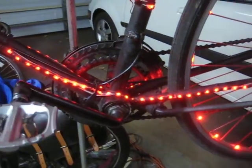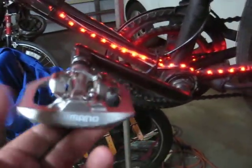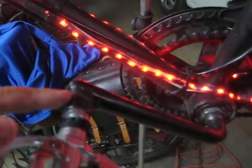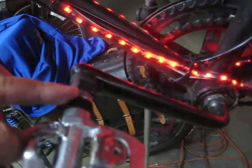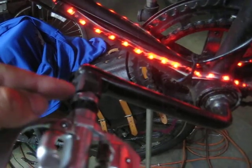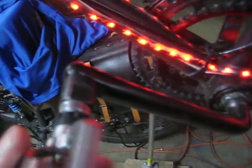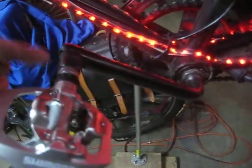It is a 20-year-old Huffy so it's certainly not fancy, but I got my $30 Shimano one-side clip, one-side flat pedals. I ended up having to get a pedal adapter because these are 9/16th inch but the hole on these old Huffies is a half inch. A 9/16th to half-inch pedal adapter is about $20, so keep that in mind if you have a problem with pedals not fitting.